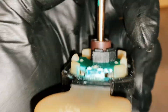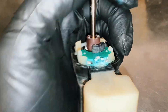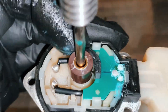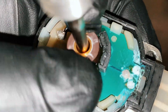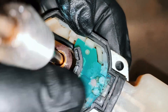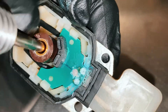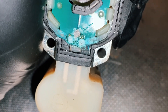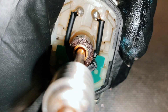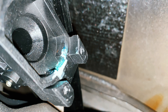Just to show you how this system works - the little brown ring there is the encoder, and that is what's responsible for creating the square wave signal as it spins. There's a hall sensor left and right, just about 45 degrees offset from each other, and as it spins left and right it creates that signal. The control unit knows exactly where the window is - whether it's up, down, in the middle, open or closed - everything comes from these two sensors on this little brown ring, which is essentially a magnet. It works basically like an anti-lock braking system sensor on a drive shaft - it's exactly the same principle. For redundancy, of course, we've got two sensors.